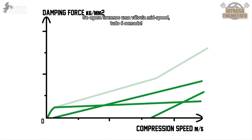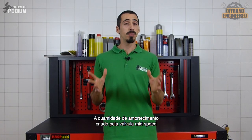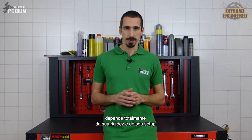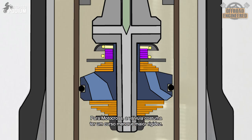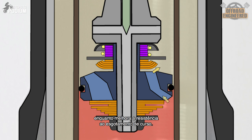If we now have compression damping in the mid-speed valve, everything adds up as well. Usually the mid-speed compression damping doesn't start right at the beginning of the suspension travel, thanks to the float. The amount of damping provided by the mid-speed valve depends completely on the stiffness and setup of the shim stack. For motocross, the mid-speed valve usually has a smaller float and a stiffer shim stack. This is useful because it provides additional damping between the low-speed and high-speed damping shim stacks — hence mid-speed — while providing better bottoming resistance.